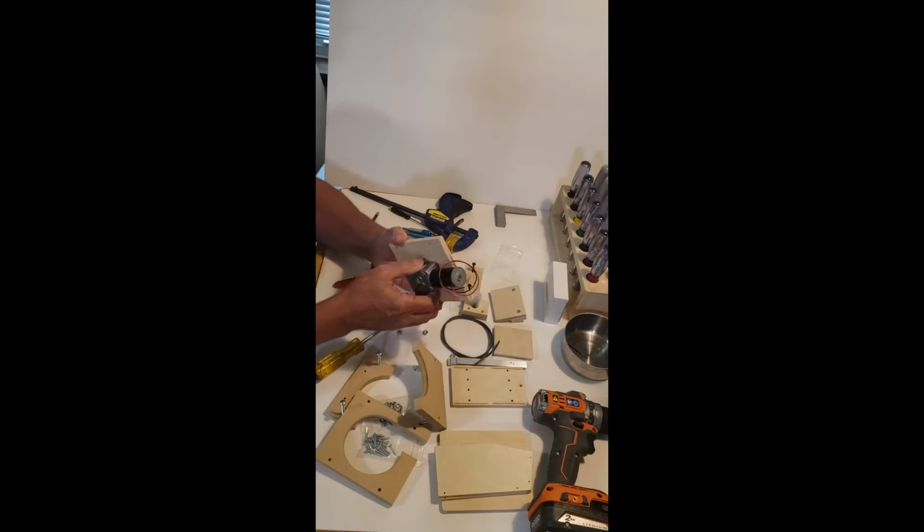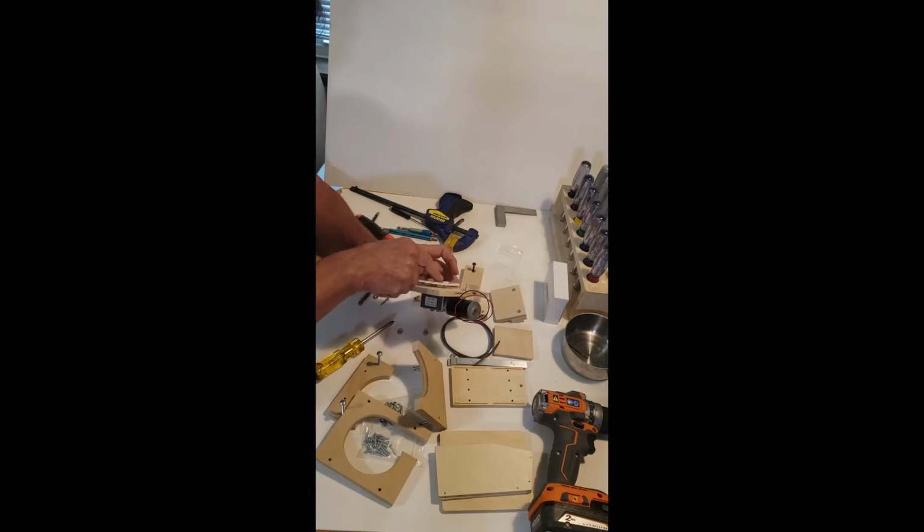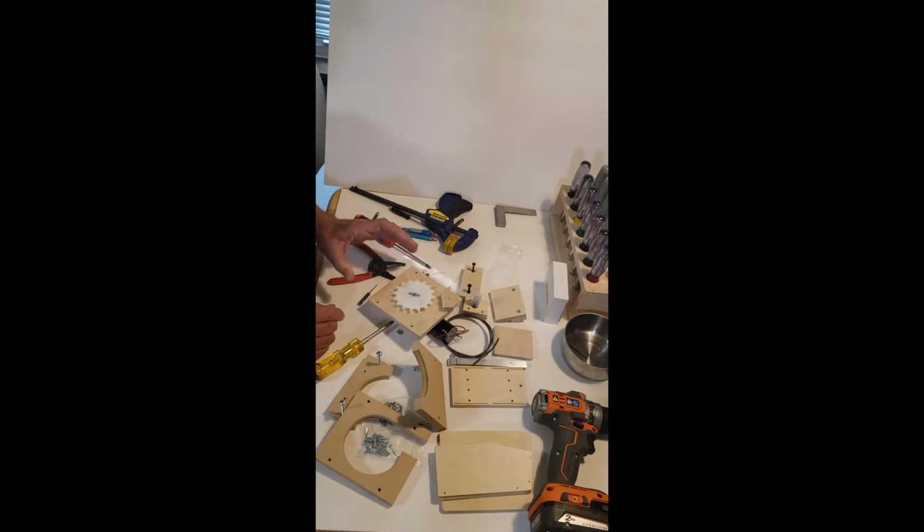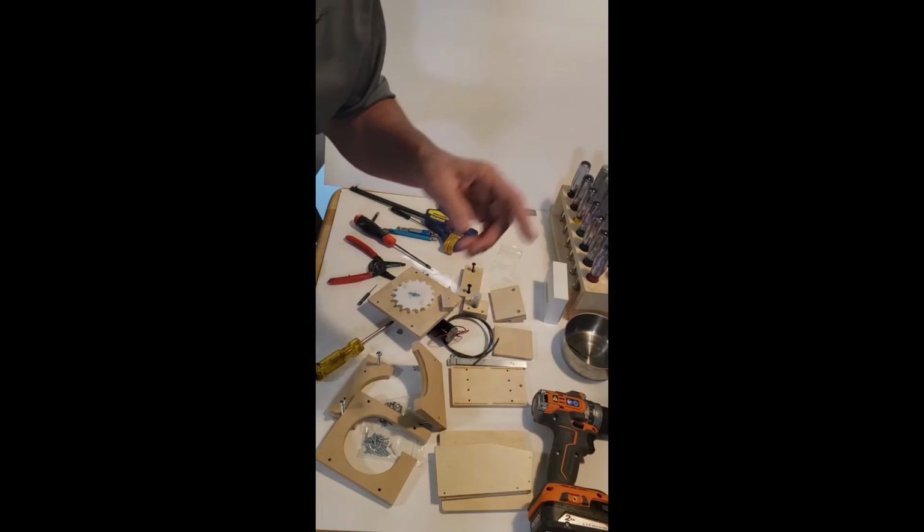This is a gear motor that is a right angled gear motor, and it has a worm gear in it. And those only work in one direction, from the worm to the gear, not from the gear to the worm. You can't turn this motor by turning it. You'll just break something. So if you need to turn it, all you have to do is get a battery and turn it, and I'm going to be right back with one.